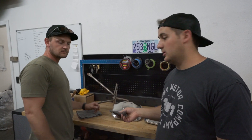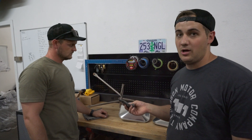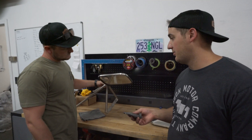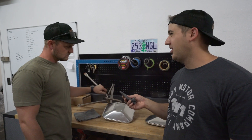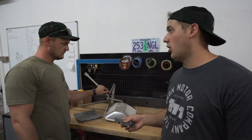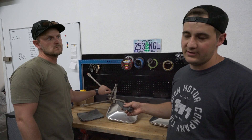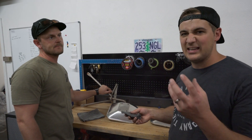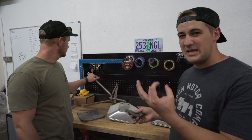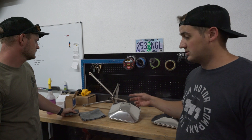Sterling's over here using triple-aught steel wool to clean up all the stainless steel and chrome. This is a trick we learned: triple-aught steel wool on anything chrome or shiny is phenomenal. It doesn't scratch stuff up — it really takes out all the imperfections, all the little flash rust. You can make old school chrome look brand new again. You can't get rid of the pits, but any cloudiness, haziness, or little bit of rust that's peeking through, the steel wool just rips through it. These are factory OEM FOMOCO tow mirrors and we didn't want to replace them, so we're just cleaning them up.